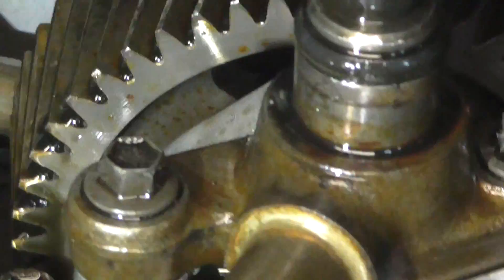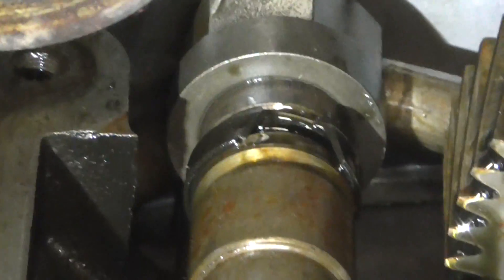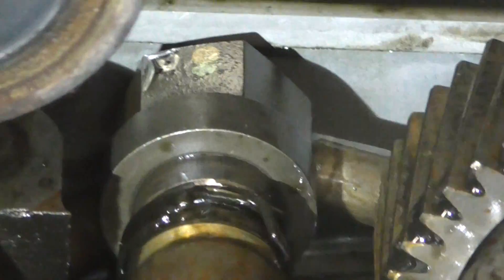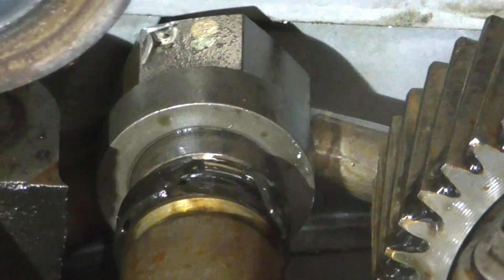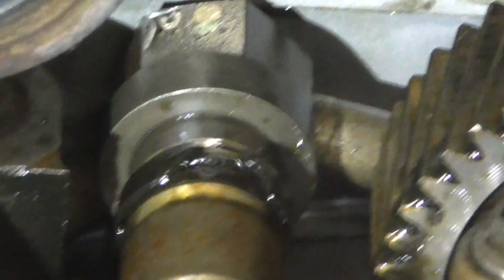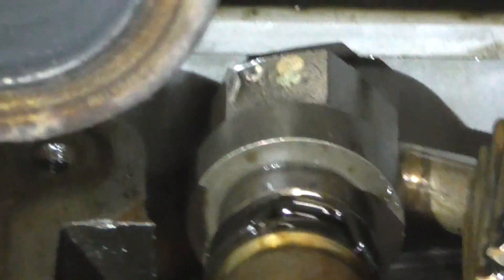At this point we'll probably just go and replace the pump again just to make sure we're good on that, and get a new supply line with a new o-ring or new fittings or whatever is in here at the disconnect. As you can see, putting shop air in there is definitely showing us where our leak is, and that's why we only hit 300 psi during cranking.